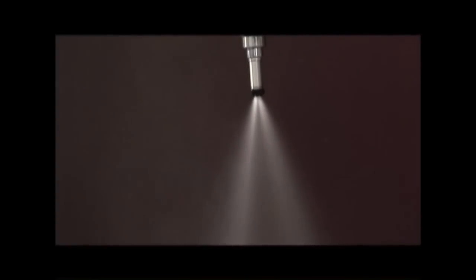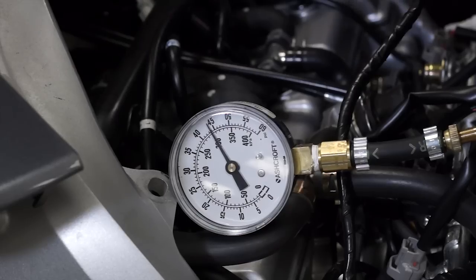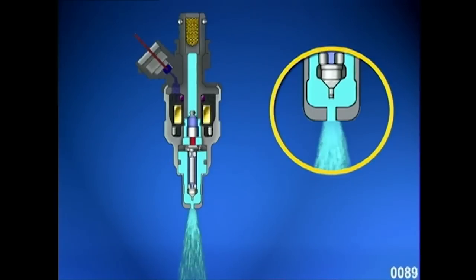If the fuel pressure is correct, we can easily determine if gas is actually spraying into the cylinder when the fuel injectors are energized by using the fuel pressure drop test. Make sure all fuel hoses are properly connected and go into the diagnostic mode, go to Diag code 36. The fuel pump will operate in Diag mode if the engine run switch is set to run and maintain the proper fuel pressure in the system. Now disconnect the fuel pump electrical lead. The fuel pressure should remain steady for at least a few minutes. If the pressure immediately starts to drop, then the check valve in the fuel pump is bad, or one of the fuel injectors is not closed — possibly sticking partially open due to fuel residue or contamination. If the fuel pressure does not remain steady, you cannot do the fuel pressure drop test.